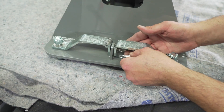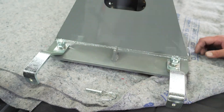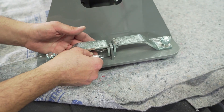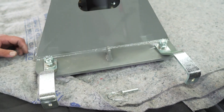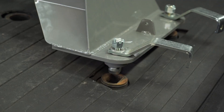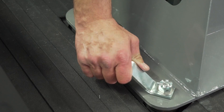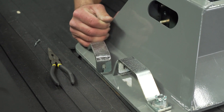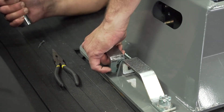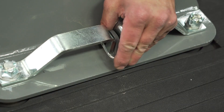Remove the latch pins from each side of the base and rotate the handles out. Then repeat the same thing on the other side. Lower the base into the truck. Engage the cams with each attachment point by turning the latch handles back to their locked position. If a handle will not turn easily, loosen the castle nut until the cam will freely turn and engage the attachment point. Re-insert the cotter pin to lock the handles.